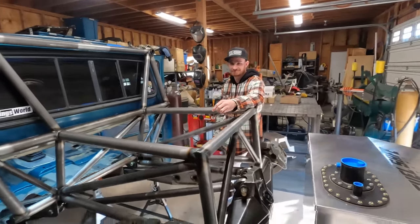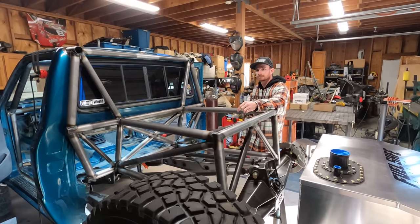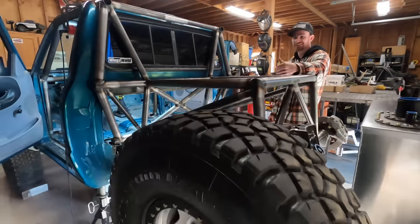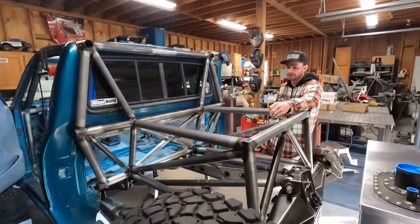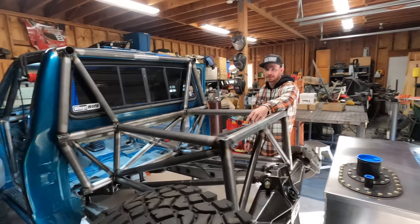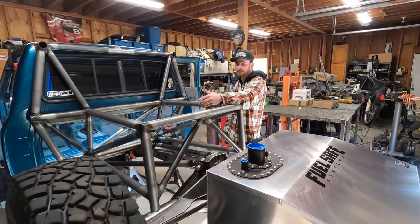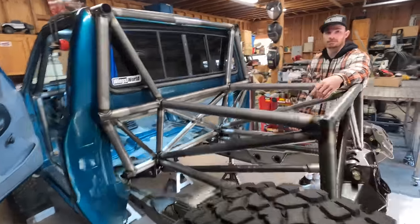You said you've got 14 inches of up travel from ride height — do you know how much clearance that gives you on the body or frame rails? I don't know an exact measurement, but my eye is working. A lot of this stuff is just visual. I know from the bottom of the tire to the bottom of the frame rail — which is the lowest point — there's plenty of room, easily five to six inches just looking at it right now. This is on a 35, which is what the truck is going to be run on initially. But I'm setting everything up to run at least a 37, so at some point when it goes to a 37, that ground clearance will be even more.